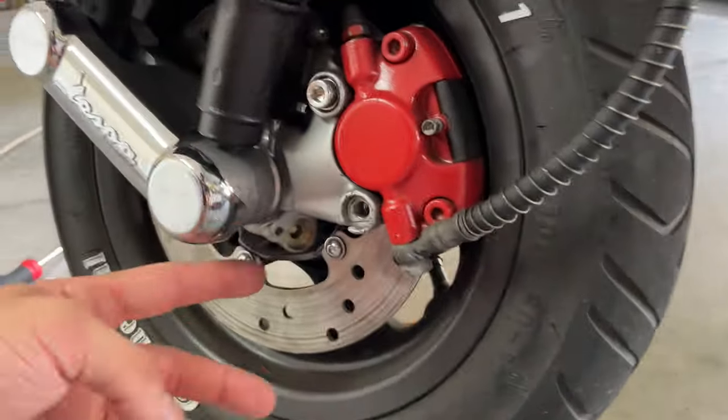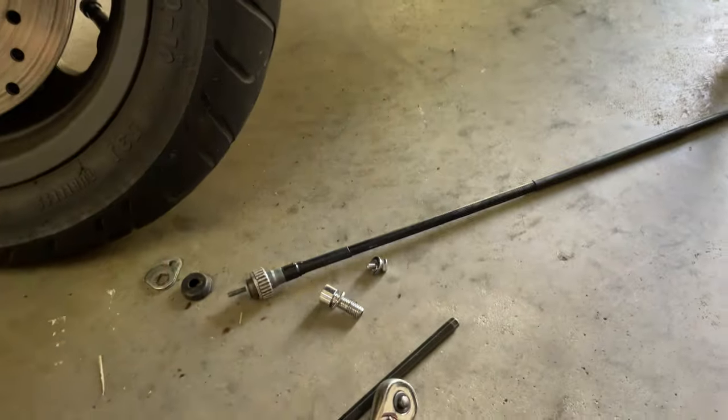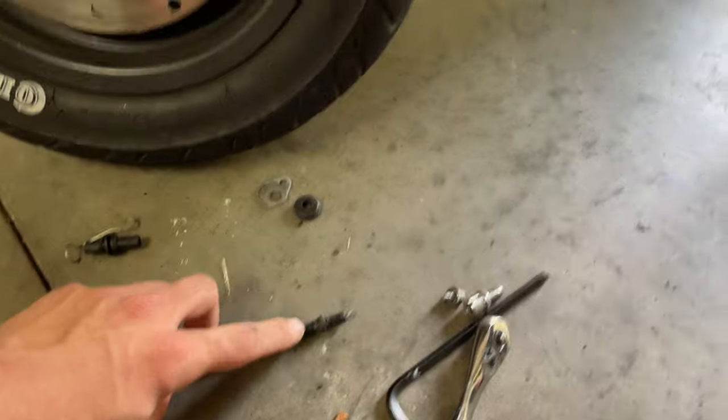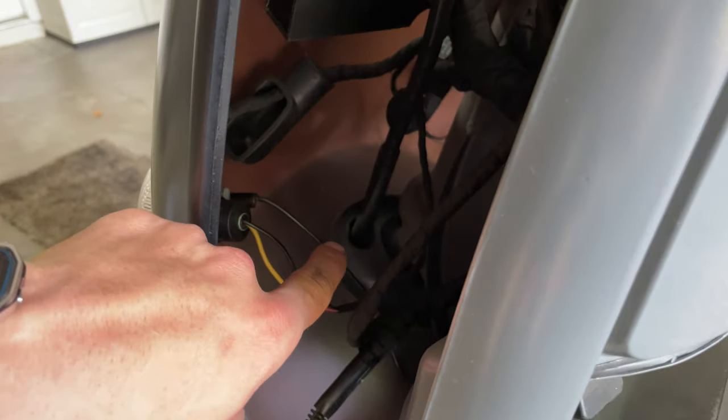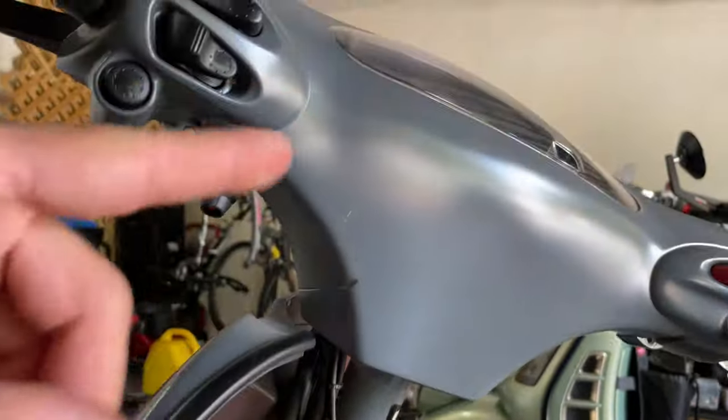Okay so after we have cleaned up the whole gear on the inside, we have our cable here ready — all greased up on the inside. We are ready to swap it back into the scooter. We are going to proceed and slide this end from here into the little hole, swap that part in first from there, and then guide the cable through over here, put the seat tie on, and connect it.